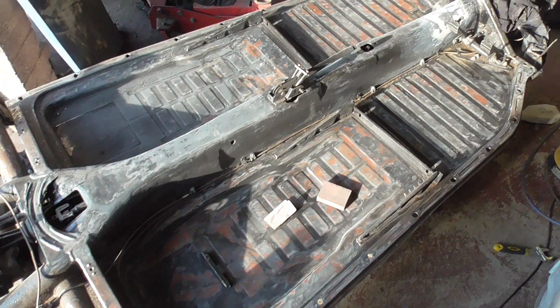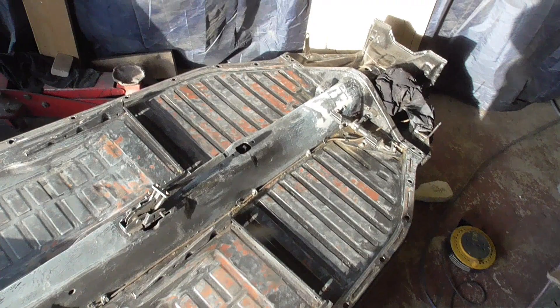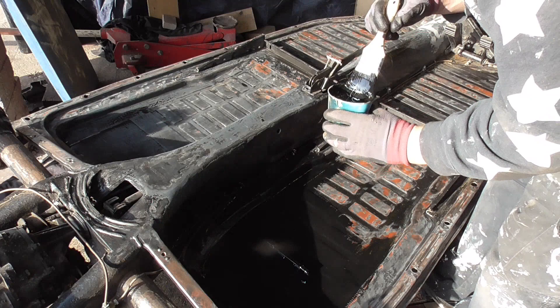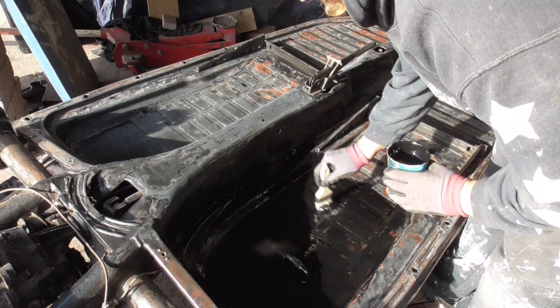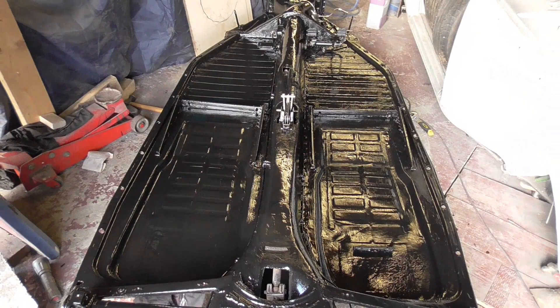I've been keying it — any loose paint I've taken off, but it's all been pretty good. There's very little loose on there, it's all well attached. I've put a tiny bit of filler on the weld points where I welded it up. Time to get some paint on. It took 500ml — half a litre — to do the top half of the pan. I'm just going to let that cure for a day, and then hopefully we can get on doing something more interesting than watching paint dry.